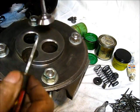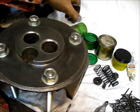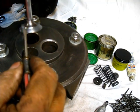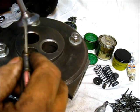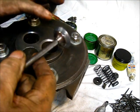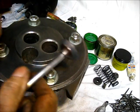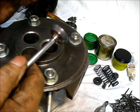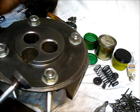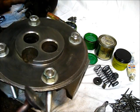What we're going to do is just apply this right here — not a lot, just cover that valve face. We're not grinding anything away. If you grind something away, you have produced a void, a low place. If you're going by the book, the head and the valve are supposed to heat at the same expansion rate, but maybe valve adjustments or something cause them not to. If you've seated the valve too deep, when one expands at a different rate, it won't match anymore.